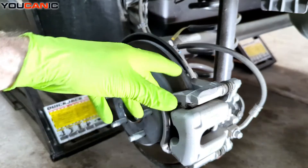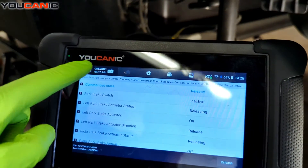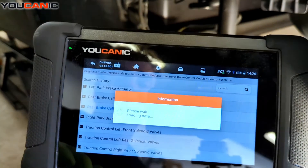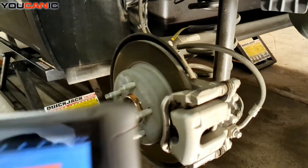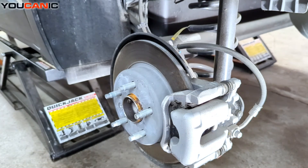Go ahead and replace your brakes, and when you're done replacing them and following that procedure, come back with your scanner and go back one step to where we can select 'Brake Caliper Piston Extend.' Tap that and hit Apply. Now the brake calipers extend until there's too much pressure, then they back up and extend a little bit, and you'll be able to use your brake system normally for your parking brake.